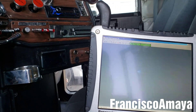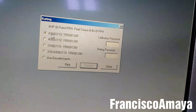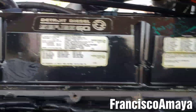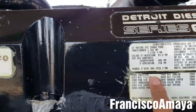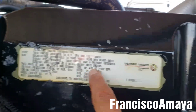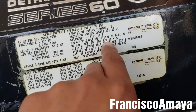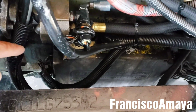We go to calibrations, click on calibration, go to ratings — and this one is very disappointing: 430 horsepower for this big truck. The Classic XL with a big engine — everybody thinks it's 500 horsepower but it's not. Let's check what the actual horsepower rating on the engine is. It says 470 — so that means this computer is not the right computer for this truck, because the max is 470 and this one is programmed at 430.